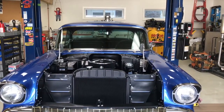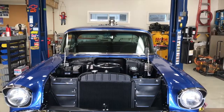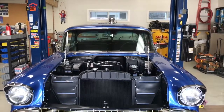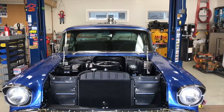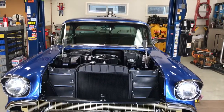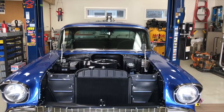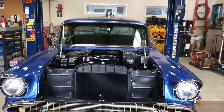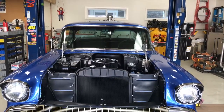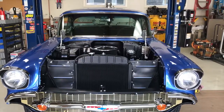Once you get it going, it does not feel like a little motor. It feels really good. It's got good power. But getting it to move, backing up, going forward, whatever, it's a chore. Not fun at all. So yesterday, just for the hell of it, we took the weakest spring, which means it would take longer to add fuel when you open the throttle. And that made it way better. It's not correct yet, but that made it way better.